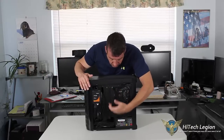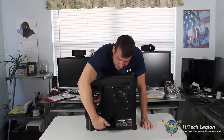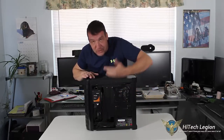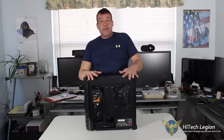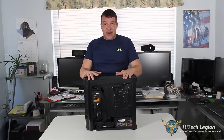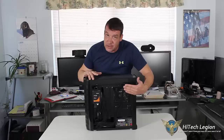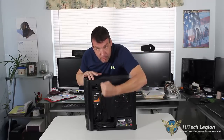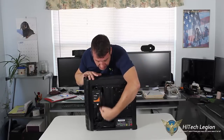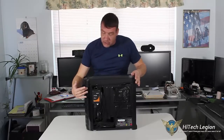When we look here, we can see that the motherboard tray comes straight up and down to the bottom. We have room for our power supply underneath. Underneath is where I have all the wires — you'll notice they're pretty smashed down together. I don't recommend that you use a bundled cable wire. Either use a ribbon cable — meaning a power supply that has a ribbon cable — or individually sleeved cables. With a regular power supply with that thick bundle, you're not going to be able to route your wires to get behind and actually close your case. You need the flatness. There is no room at all to work in the back here.